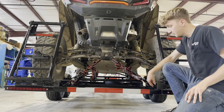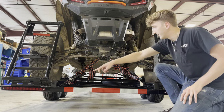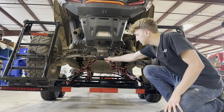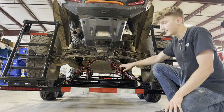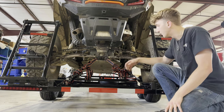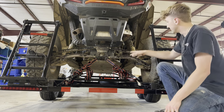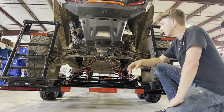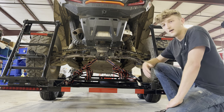Here we have two frame straps — one on this side and one on that corner. You just strap it straight to the frame with a regular strap, preferably without too much slack. So the tire straps keep the front end secure while the frame straps keep the back secured and on the deck.